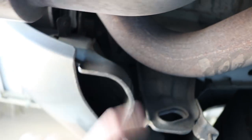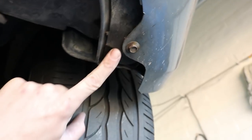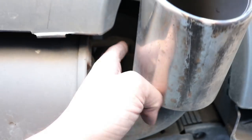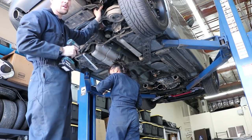Then you've got your exhaust muffler, which has bolts - I think there's three on each side, so three up here. You have to remove this bracket which can be a pain sometimes. You've got a 10-millimeter here, 10-millimeter here, a couple of clips, and another 10-millimeter up here - that'll give you clearance to get to the three 14s. Same thing on the other side but you've got your fuel vapor canister in the way, plus another bracket with a couple of 10-millimeters. Then you can get to the 14s holding that side of the exhaust bracket. I'm probably just going to slip the bushings off the exhaust rubber hangers and do it that way.